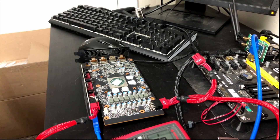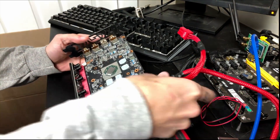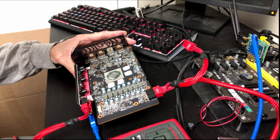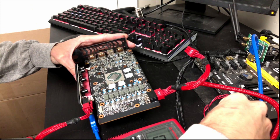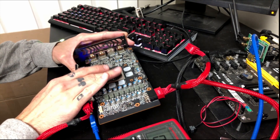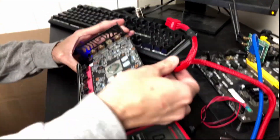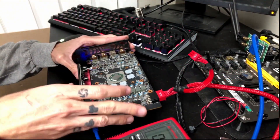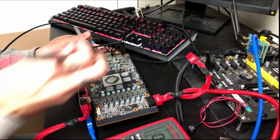I don't have the best bench recording setup here but this will have to do. I've got everything connected, powered by a riser and an eight-pin cable. I'm going to turn the PSU on and just in case something blows I am ready to switch it off — I've got the power supply switch easily accessible. Let's power it on. I always put my finger on the core right here. You do have to be careful with 30-series cards because this gets extremely hot, but there is no heat coming from this, and my riser is powered, so we should be getting power — but we are not.